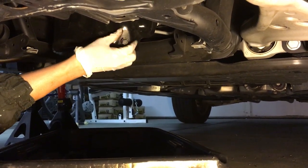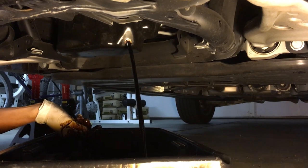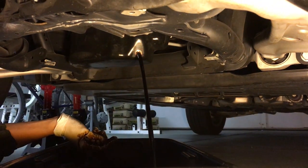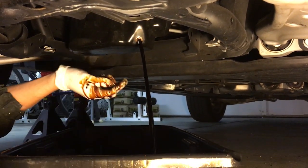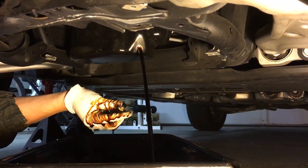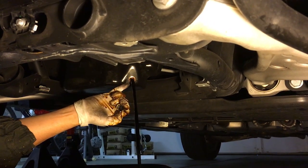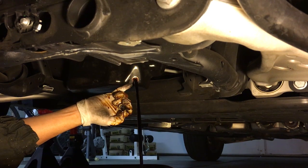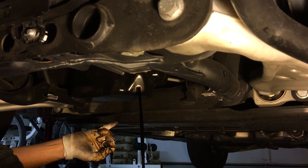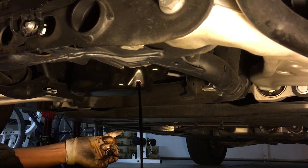Okay, make sure that you get the washer out as well. Sometimes, there we go, you see the shoot, the arc is so far that if you didn't get it over here, it's gonna shoot on the floor and it's gonna be all over the place. And this is a good time to wear gloves too. Right. Why don't you show us your hand, Dad? Right hand, right here. You can see that without the gloves, your hand will be all over. And look, I am holding on to this one. Remember, the ML350 has almost 2 gallons of oil in it, so it's gonna take a while. And the catcher has to accommodate that. You know, the last thing you want is for the catcher to be over full and spill all over the floor. And you will have to lie on it in order to work on the car.